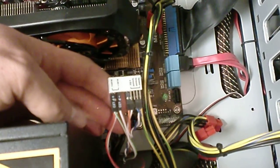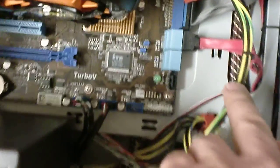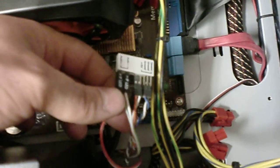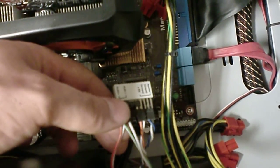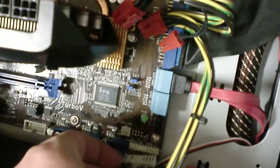The biggest thing to focus on when you're installing a new motherboard is, believe it or not, the front panel adapters. That there is a dummy block, and the reason I call it a dummy block is because powering your computer up at the top, your power buttons, your LEDs that light up while the hard drive's being used, they all run off of a specific part on your motherboard. It's imperative that you remember when disconnecting them where they go, or if your manufacturer is so kind, they'll give you this, which pretty much labels it, so you can attach the cords that you see right here to the dummy block. Then the dummy block will very easily attach to your motherboard, just like that, down at the bottom, no questions asked.